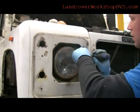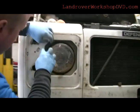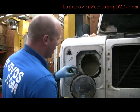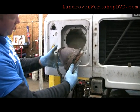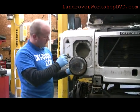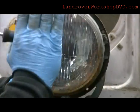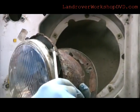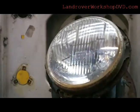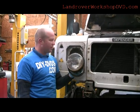I can't believe how well this is all coming undone. If you get problems with it, the bits on these cars are so cheap — just rip it out and buy a new one. Three screws in the headlight bowl and away we go. A bit crusty so we can change that for a new one of some sort. Just a point of interest — you can have a look at the headlight unit. There's one of the adjusters for your beam, and one there — so it's adjustable on two planes with two screws, and the other point is fixed. Three screws hold the little silver ring that holds the old headlight in. If you go as far as doing that then a definite headlight upgrade is all for the course.